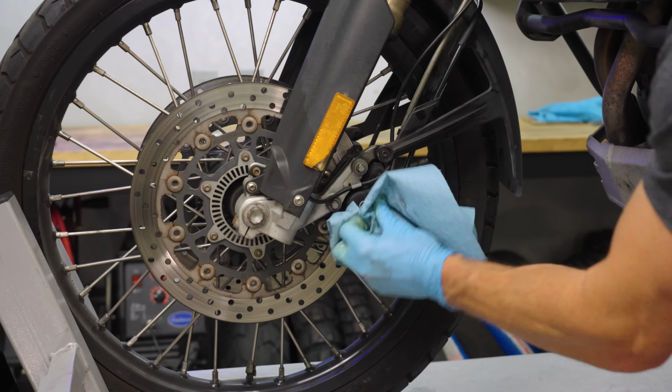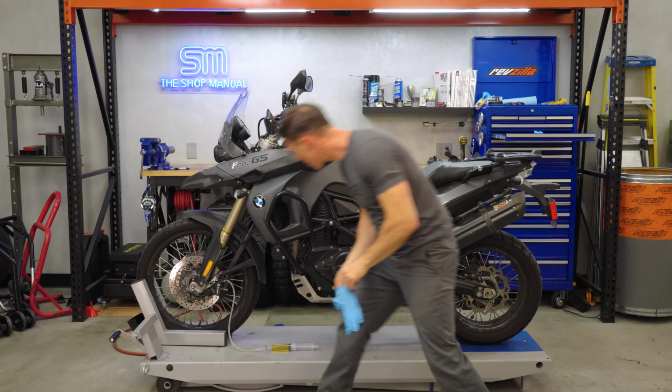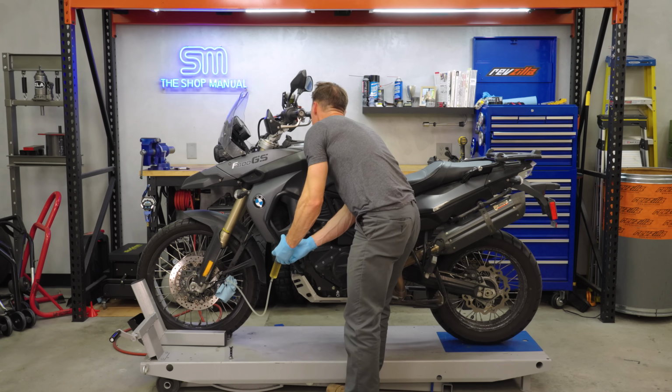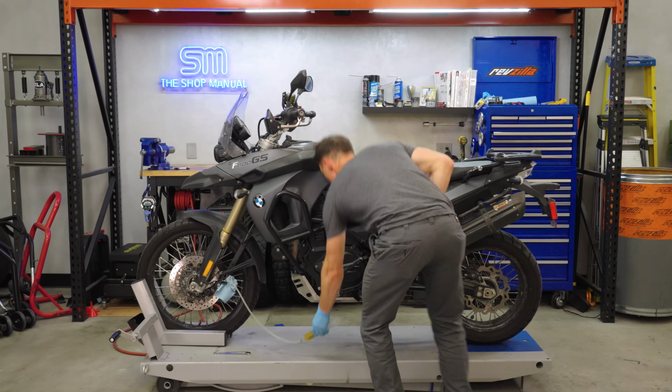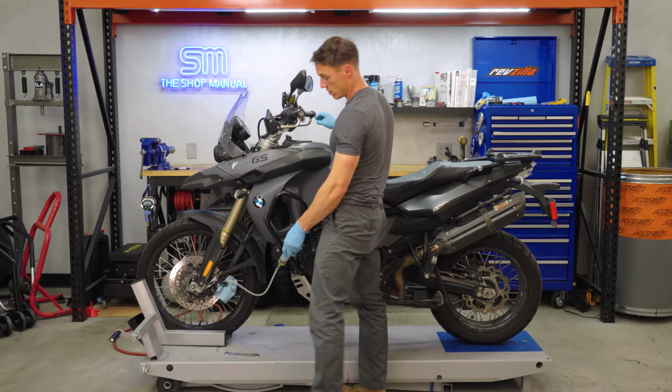Of course, if you have a twin caliper setup, then you're only halfway done, but ultimately, the final step is to bleed the brake system. And since the calipers are empty and the hoses have drained down quite a bit, the quickest way to purge the system is to reverse bleed from the calipers up. We've got a separate video on that. I'll put a link in the description.